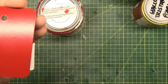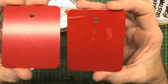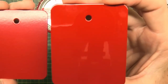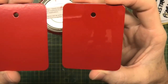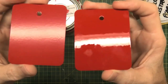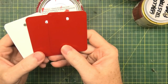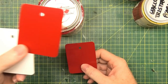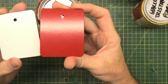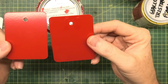This is the same sample but now with the clear gloss 2K over the top of it. You can actually see my camera in there — super, super glossy. And that brings out the real colour of the Rosso Corsa Red. That's pretty simple for solid colours. It doesn't matter what you're spraying, whether it's a solid yellow, a solid black, a solid blue — same theory. 2-3 light coats of base colour over your primer, and then finish it off with some coats of 2K clear.